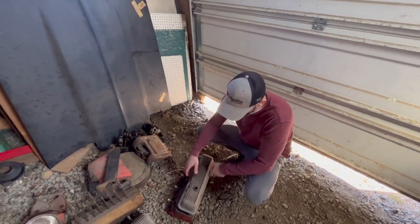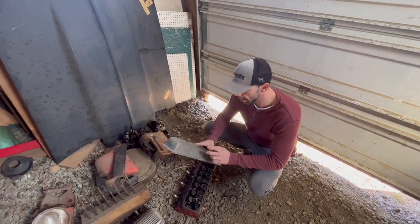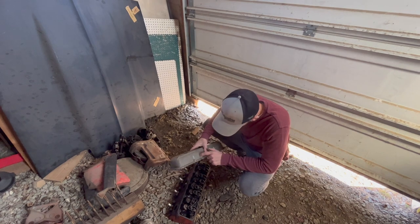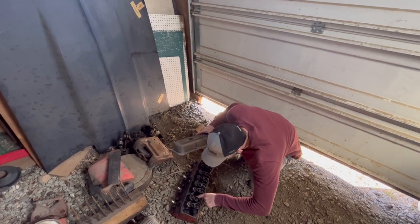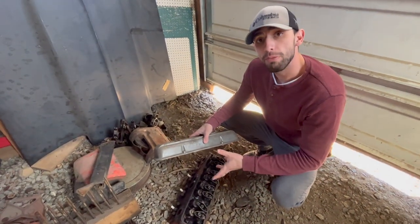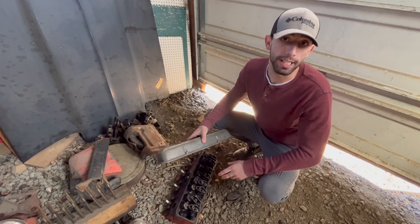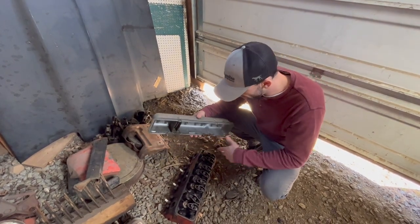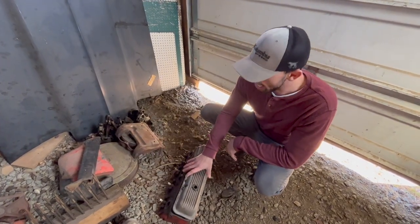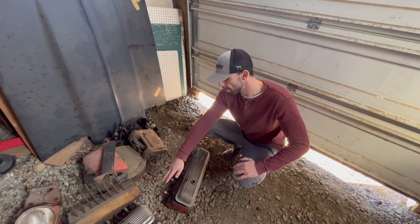But these are Corvette valve covers. Now, if this was a Z28 head, these valve covers would actually be a little bit dull. The Corvette ones were like a polished. With the cover off here, and we look at the tag here, we see 3927186. So these heads would actually be Z28 DZ302 heads, but they're date coded 70, so they would be from the Corvette. And if they were date coded 69, of course, we would be looking at some gold. But it didn't work out for us on that one. Still a good piece, still double hump heads, still worth a decent amount of money. If you find them, remember, look for the lumps on the side.